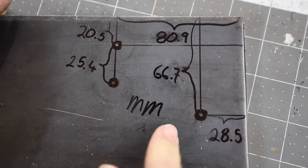This is something I wasn't originally going to do, but to get proper water runoff we need to add some little guys that flip up, so we can add some peaks. That way if we get rain, it'll shed off nicely. I'd like it to work without guy lines, but we'll still have that option since we sewed on little tabs. I'll have to remove a bit of paint to weld, but it'll be worth it. These little peak supports are made from half-inch conduit, nine inches long, with two small brackets welded to the arm of the awning. The fabric will hold them straight up — no stops needed.